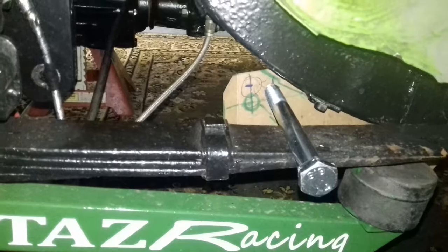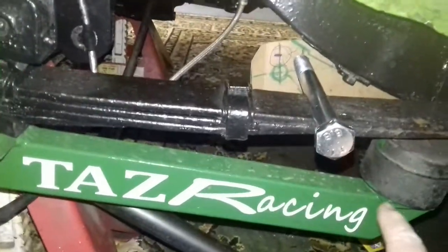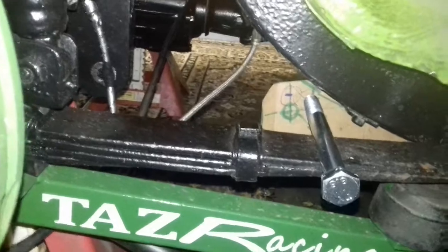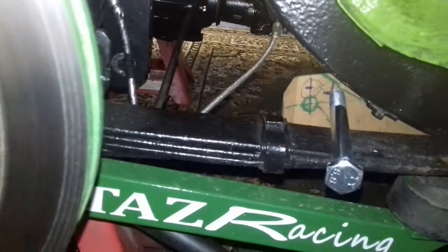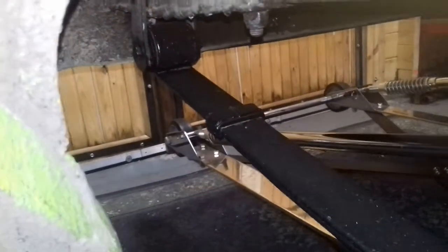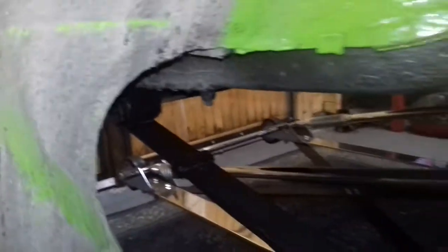So what I'll do is take a cut of the video and show you the bits and pieces that I'm going to do and not going to do. Obviously this anti-tramp bar on the bottom there, that's all going to come off. At the moment I'm just in the middle of fabricating some brackets — you can see those brackets at the back there. There's going to be one there and one at the front somehow. And then also at the back, where the back leaf goes into the shackles, the shackle is going to come off and I'll make some sort of sliding system so the leaves can slide. So that's the kind of plan.